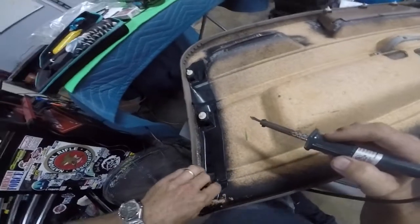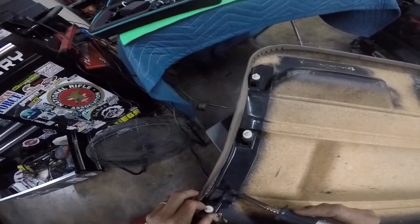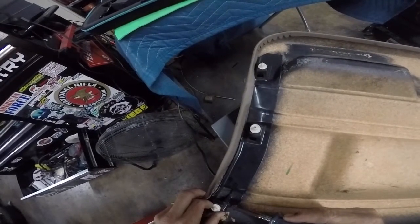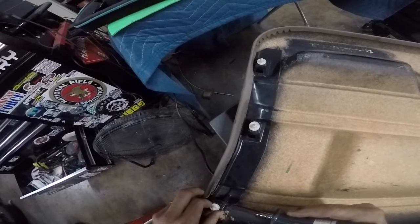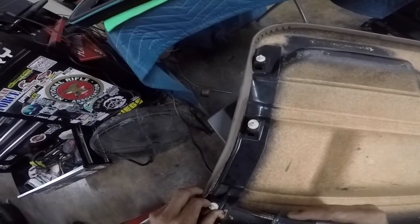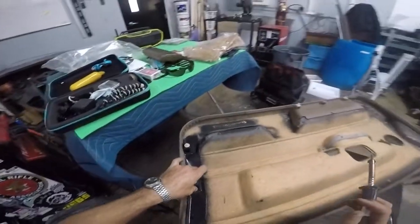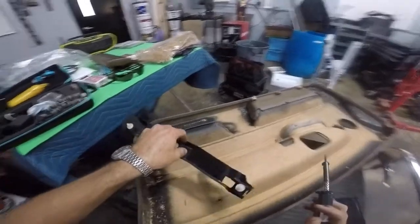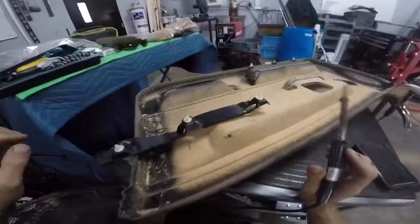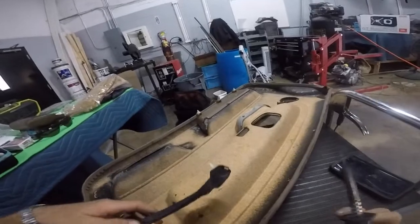You can use other fillers, other pieces of plastic. They kind of have to match the style of plastic that's already in here, though they don't have to be exact. Just a little sweeping motion, same as you would with a regular weld, so you can get a good filler bead there. Now that I have the rough structure of how it goes, I'll take it to an area I can work in a little better. As you can see, that's actually holding on there already.